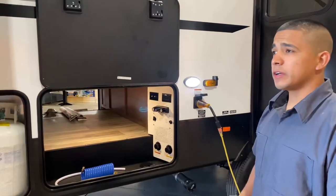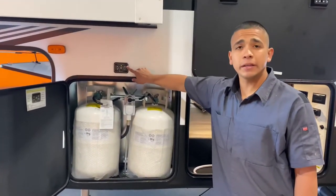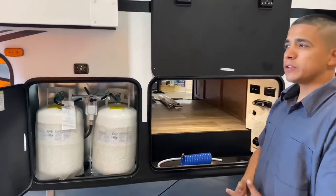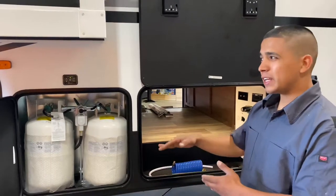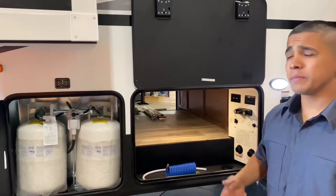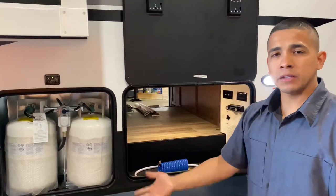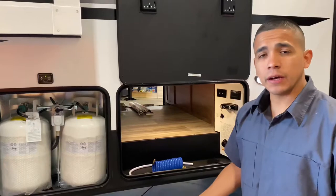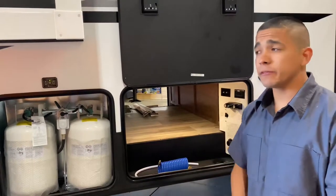Now I'm ready to hook up my truck. I want my back legs up. There's a button here that says hitch height — if I hit that button, my back legs will come up and my front will adjust somewhat to where my truck should be. After the trailer hooks up to your truck it'll be more adjusted, but I still recommend looking at the hitch before you're completely hooked up. Hitch height will bring my back legs up. Once I'm locked onto my truck and I know it's secure, I can hit retract all and all my jacks will come up completely, except for the manual part which you'll have to do yourself — pull the pin and pick the rest of your leg up. Make sure the pin goes through the other side of that leg so you don't lose one of your front legs.